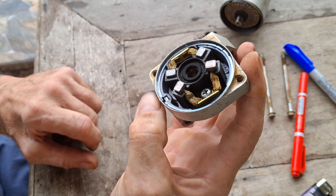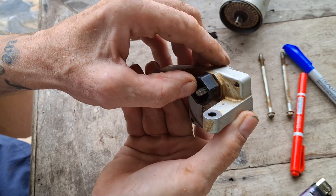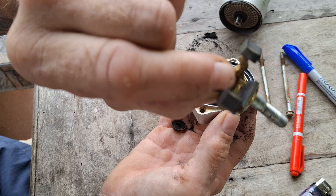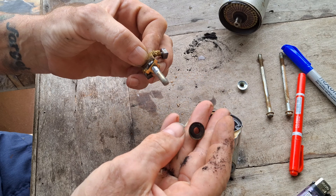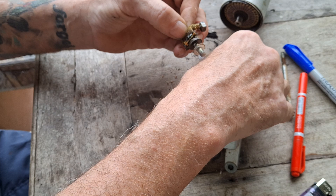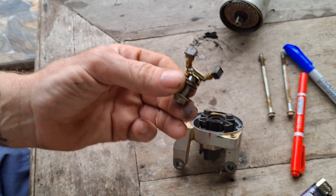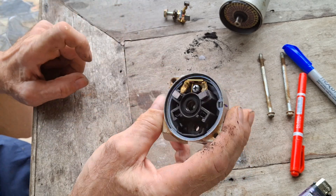So I think I'm pretty confident now — I have found what is messed up. And I was right. Technically speaking it wasn't the end of the world, but in order to get that pair of brushes out you have to remove the nut on the casing. There's an isolator washer there — let's not let it short out, don't go losing that. And then there was a nut. So that's one pair of brushes which we need to replace, and of course the other pair, held on with a screw, we'll be replacing as well.